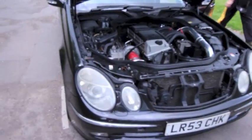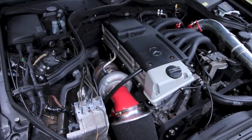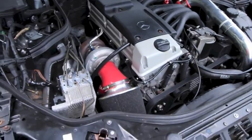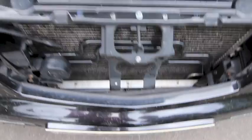Top and bottom of it is, we didn't. We took the common rail out and we put in an OM605, which is excellent as you'll see later on in this video. And we put our new BorgWarner turbo kit on, which we get all excited about, using the stock intercooler and many, many other components from the original car.